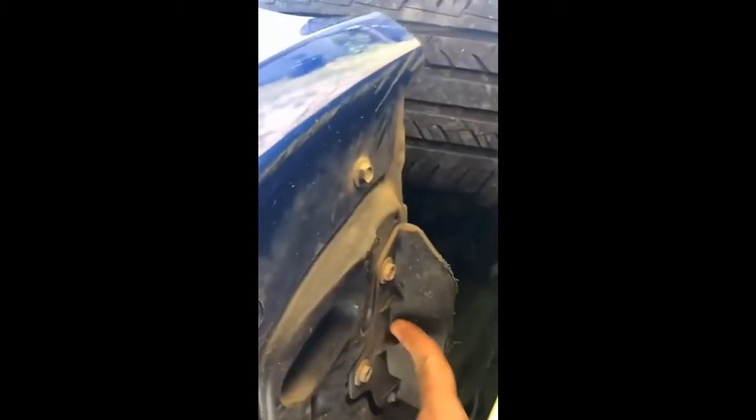Over here you'll want to pull this off and you'll have this rubber skirt piece. You should actually be able to sneak in behind it. You'll need to address the clips that connect into the bumper — you want to pull out whatever connects to the bumper. These here can stay; it's just these outer side clips attached to the skid plate. You're also going to have a 10 millimeter bolt right here you've got to take out.